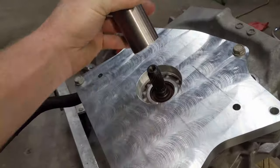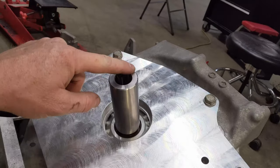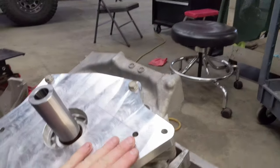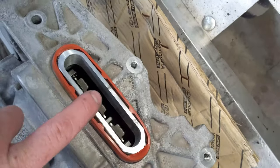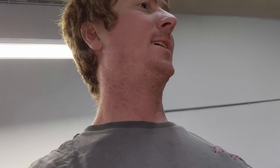This is hardened steel, so what I'll do is have the driveshaft shop weld onto here to get the new driveshaft onto the input of the transfer case. That's my plan at least — we'll see how it goes. Right now I'm going to test-fit this motor into the new motor bay underneath the cowl and see how it fits. We'll also see if we can fit the inverter on top of it. I don't think we're going to be able to fit it on top, so we'll have to do something else, because you can see the three plugs from the inverter to the motor — this is an AC motor, three-phase input. I need to figure out how to make those connections.